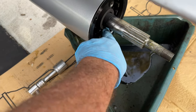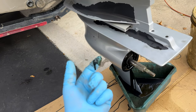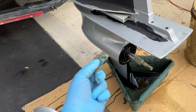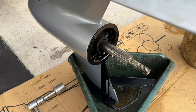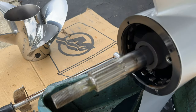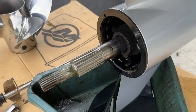While it's draining, stick your finger right where it's coming out. Take a look at your finger and make sure there are no particles in there. Rub it — you'll be able to feel it if there's any grit. It's very important to check that you don't need a repair, because putting it away for the winter, this is the time of year to have it done. Let that drain until it's all out — it's going to take about 15 to 20 minutes. While you've got your prop off, make sure you don't have any fishing line stuck inside that little seal, because that could blow your lower unit. Check for fishing line on a regular basis — pull that prop off a couple times during the summer, because that will make for a bad day.